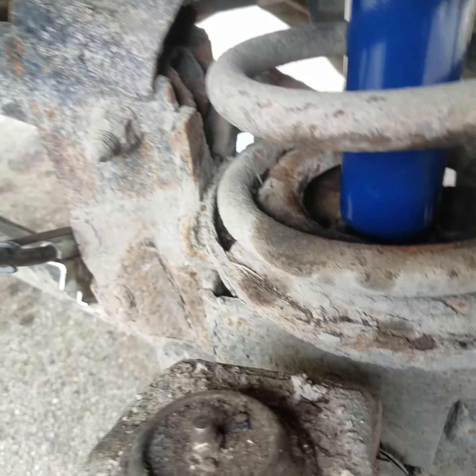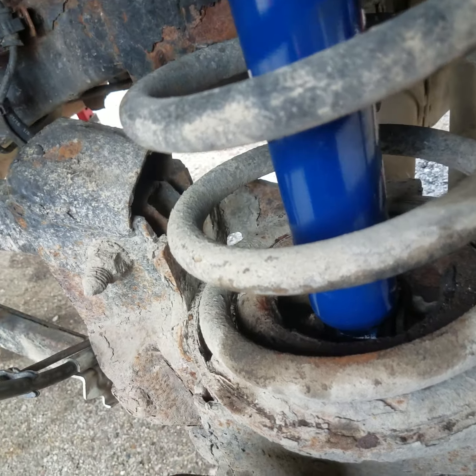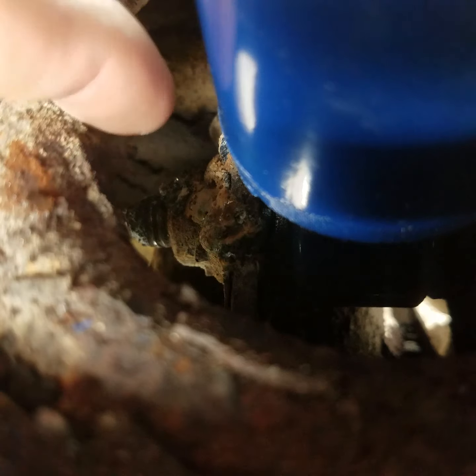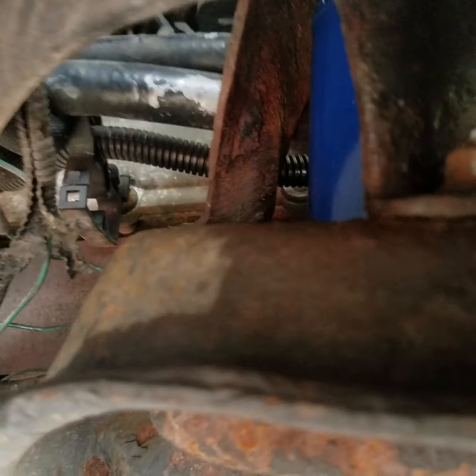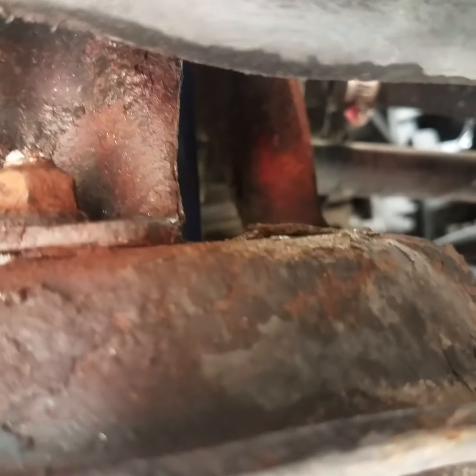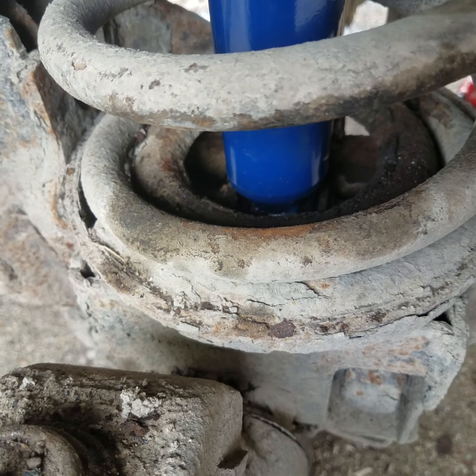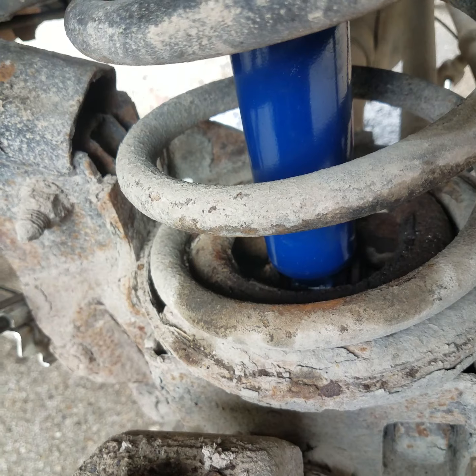You've got two different options. First option: if you have a welder, get in there and weld that clip right down in there — the one that's got that slug that the bolt's sticking through — weld it onto the bracket where the shock goes. Then you can remove the bolt and put your new shock in place. After you remove the tire, right up in the fender well, you can actually get there from above — just take the air filter box out, remove the bolt, cover with anti-seize, put the new shock in, put the bolt back in, and you're done.